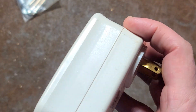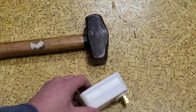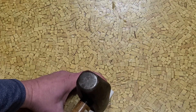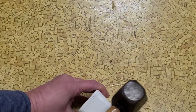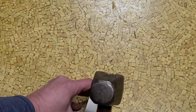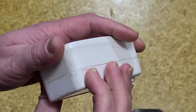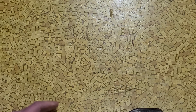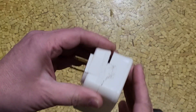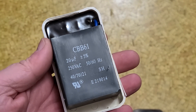They glue them together or ultrasonically weld them, but I have some tools here that I believe we can get it open with. With many of these glued-together type packages, all you have to do is just crack the plastic — sometimes just hitting it with a hammer a bit can many times get it pretty close to coming apart. This thing is glued together pretty well, but that's all it took. And as I was talking about it being a capacitor — that's what it is. It's a motor capacitor.